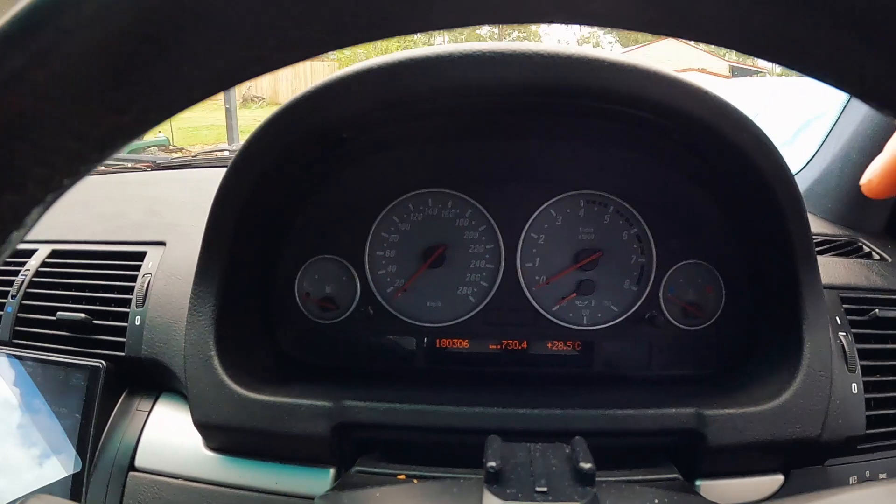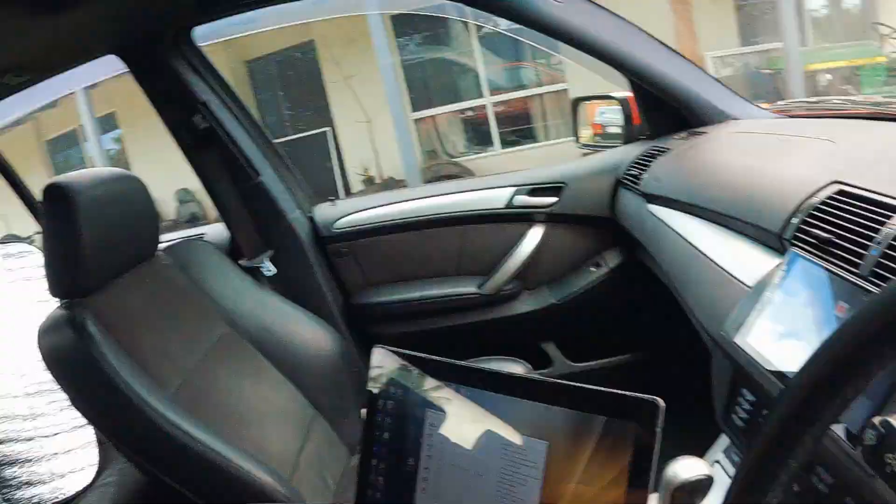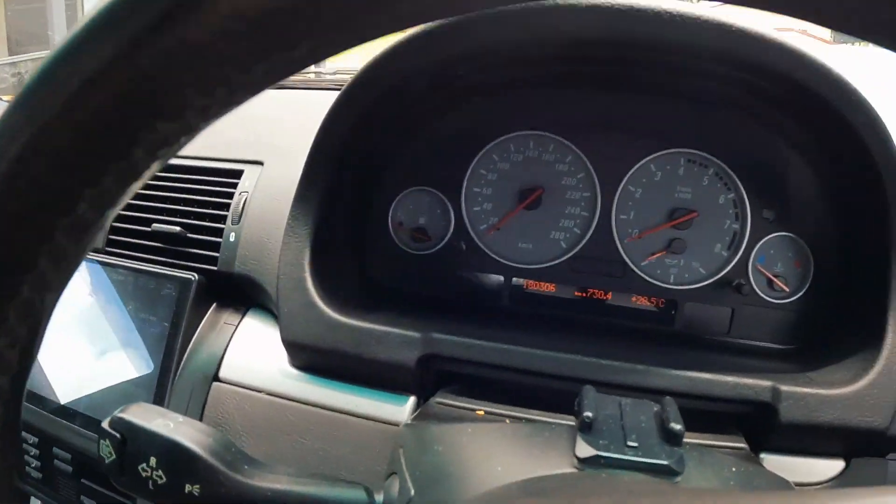Welcome back to another episode of Zero 60. On today's episode I'm going to try and get rid of the Tamper Dot. We've had this X5 for probably a bit over a month now. Had a few issues with the transmission which we managed to fix, and the first week it was on the road we developed some issues with the light control module — the indicators weren't working on the inside of the car but were working on the outside. After a horrific amount of diagnosis we ended up swapping in an LCM3 module from a 535. That got the car sort of functioning but we were getting some errors on the dashboard and it brought up this Tamper Dot.